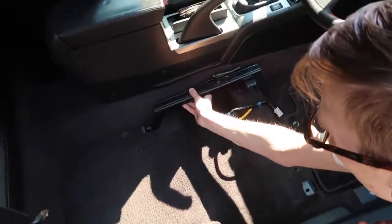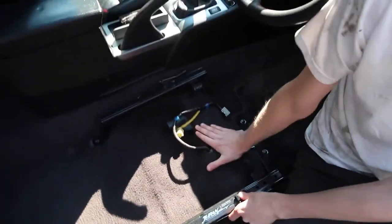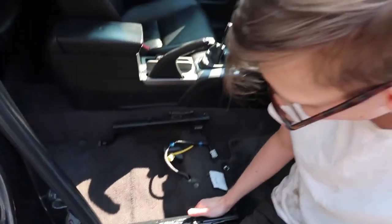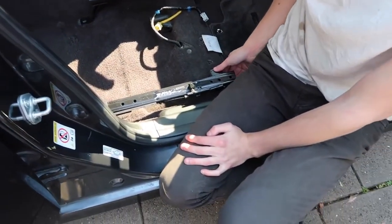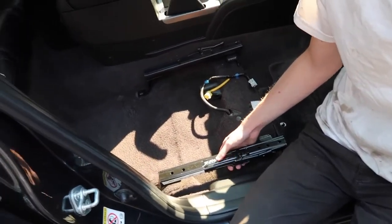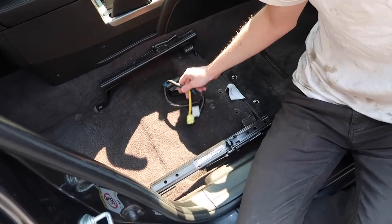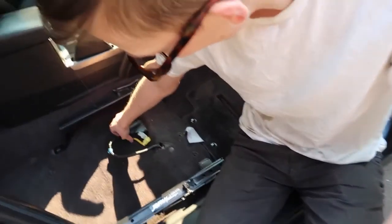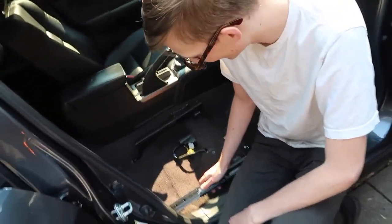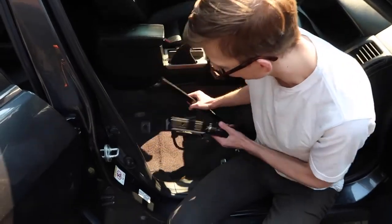Looking at the fitment in the car — that'll be that side, and that'll be that side. To assemble it, you bolt the seat to the brackets, the brackets to the rails, and then drop it all in in one go. I do have a Recaro airbag delete kit at home — I just forgot to bring it so I'll plug it in later. It doesn't really matter anyway since I already got the airbag light from the steering wheel because we need a boss kit with the airbag delete.